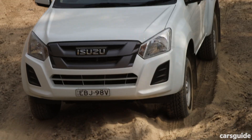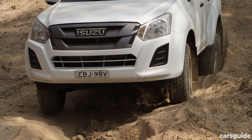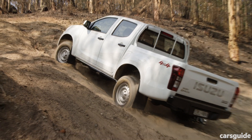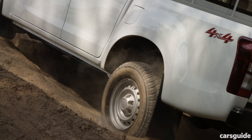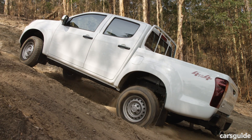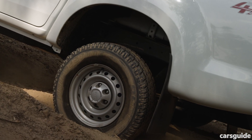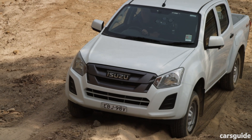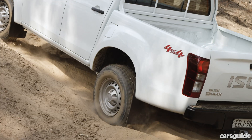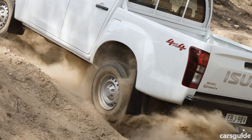The D-Max is generally a good off-roader — it's got decent ground clearance and good wheel travel. But the problem is when you get on a steep hill with deep ruts and loose gravel, its weaknesses are exposed. It relies on traction control, and traction control is not enough for something like this. With no diff locks, I'm not going anywhere. I could go harder and faster with a bit of a run-up and get further up the hill, but that would risk damage. To note: I had a few cracks at this hill with traction control on and off, and in both high range and low range.